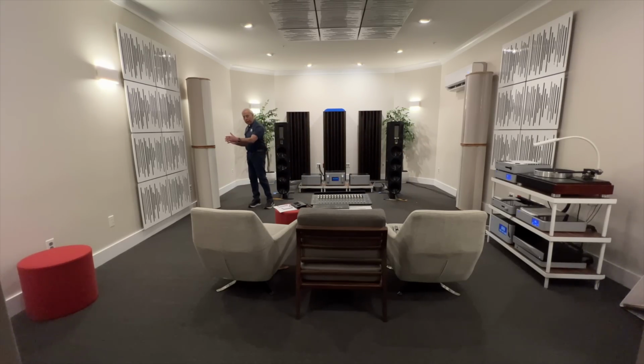And those were just done by hand, moving them, listening to where it made the sound stage very wide, because we don't want the tweeter to go over here, hit the wall, and bounce back to the person out of time. The FR30 is a monopole speaker, meaning that the sound mostly comes out of just one end of it, the front. Sound comes out here, hits the wall, and mucks up the way the sound is presented, because when it's reflected off this wall and comes back to the listener, it's out of time.